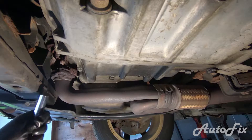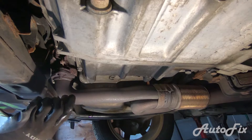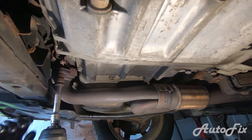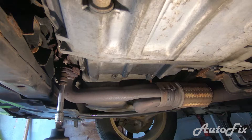As you can see here, we have three bolts at the front. I'm going to try and break them loose with a 3/8. They should be 14 millimeter. I'm going to use an impact socket — hammer it on and make sure it goes on there tight — and use an impact gun. That plan didn't work because the battery just died. New plan: I'm going to use a pneumatic impact and hope that takes all the hardware off.